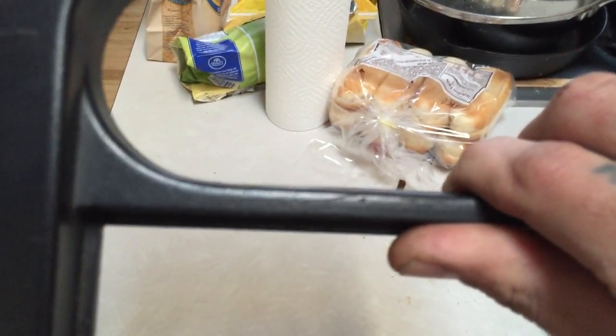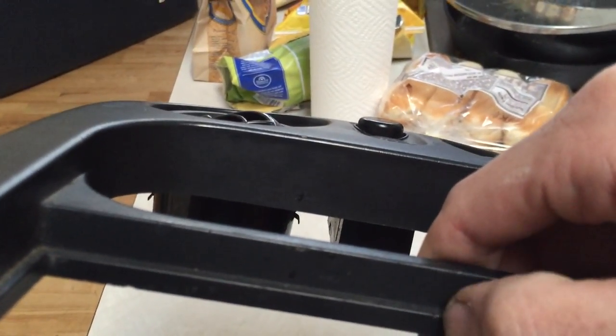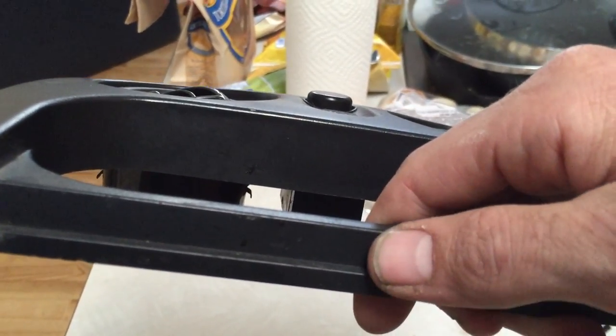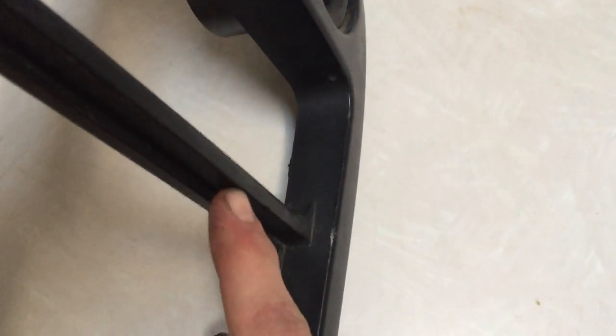So what you do is, as you're cutting down — you can see this level right here, this step — I took that step out and took some more away. There's a lip under the AC controls; it lines up with the AC controls, then drops down and goes back towards the stereo. I wanted to cut all of this off right to the back of that lip so the iPad would sit flush against the surface — as far forward as possible. That lip becomes your guiding line for how deep you go.